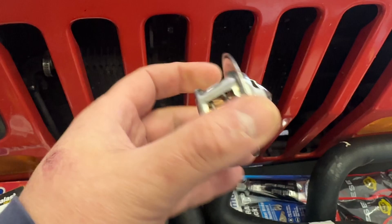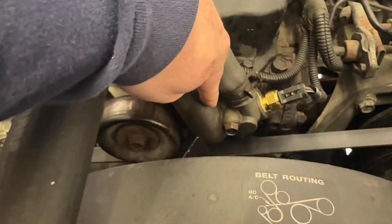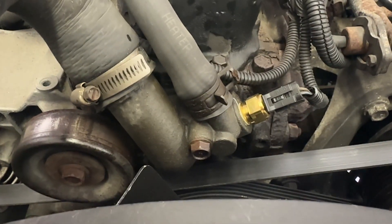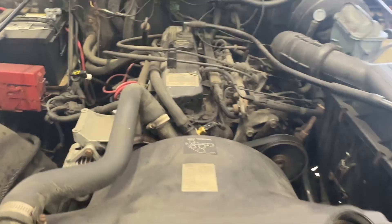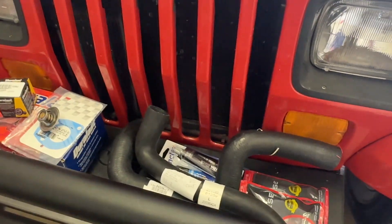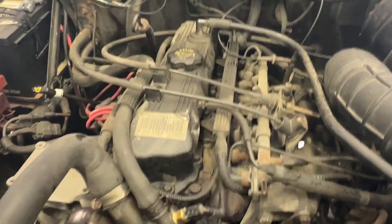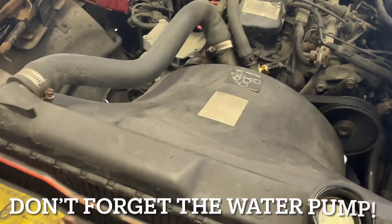There are a ton of videos on this already online so I don't think I need to cover it in detail. That thermostat lives inside the thermostat housing. Hopefully those two bolts come free — I've been dousing them with PB Blaster and Deep Creep products for the last week, so fingers crossed. I'm trying to build this thing back up as reliable as possible, so I don't mind putting new parts into it: new thermostat, new sensor, new sending unit, new hoses, and a nice flush and fill on the radiator.